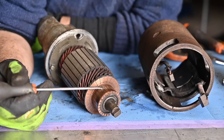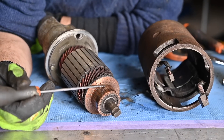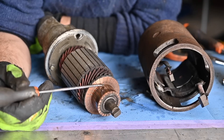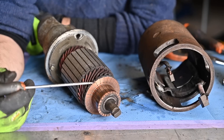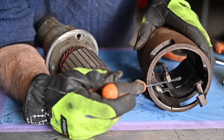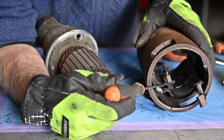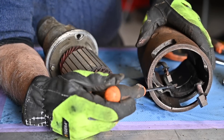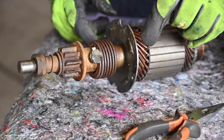That's where the brushes slide over, and it's not too bad. I'm just going to clean that up with some very fine abrasive paper and see how good this still is. Inside the unit you find these two big coils — these are actually electromagnets, so they magnetize the whole field. In new starters you have permanent magnets quite often, but not in this type.